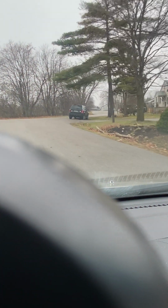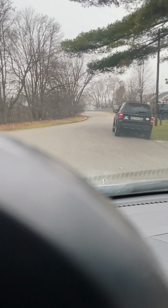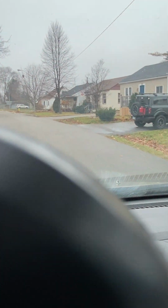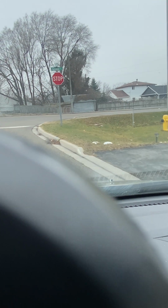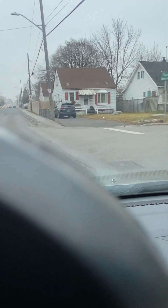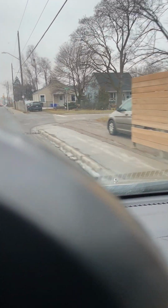My steering wheel is back to normal now. I don't even feel any difference. And the reason why it was hard and stiff, maybe there was a shortage of oil. There was not much oil left in the lines. Also, it was hard because it was taking air from that leak into the system, and that air was causing the problem.